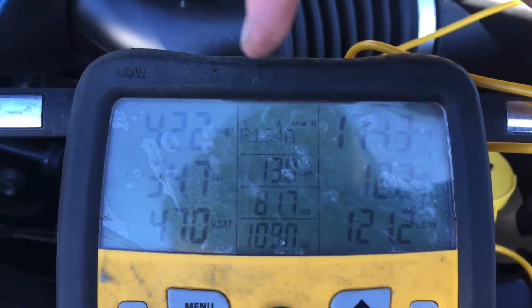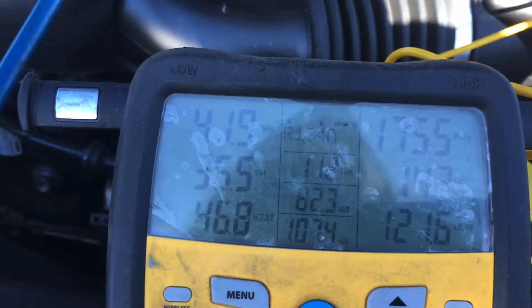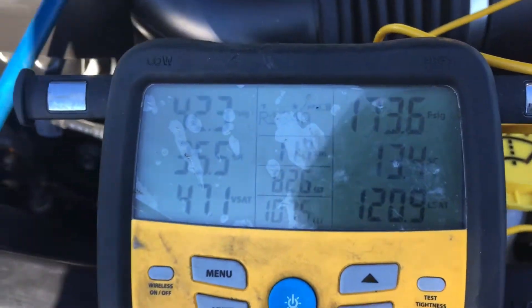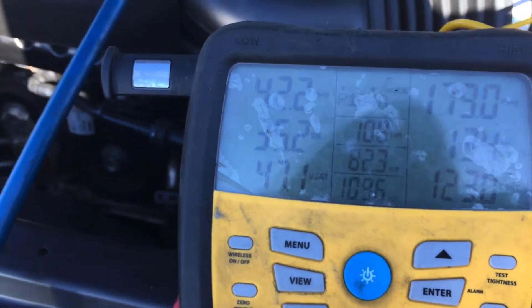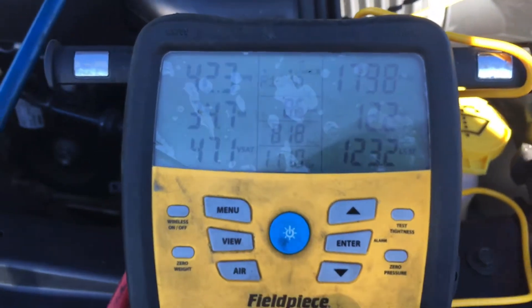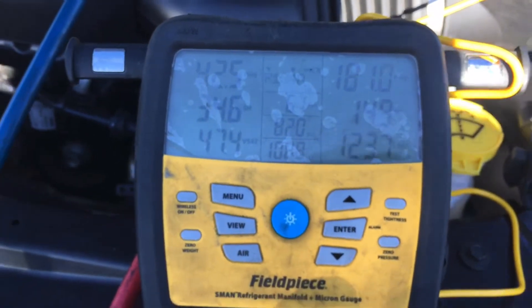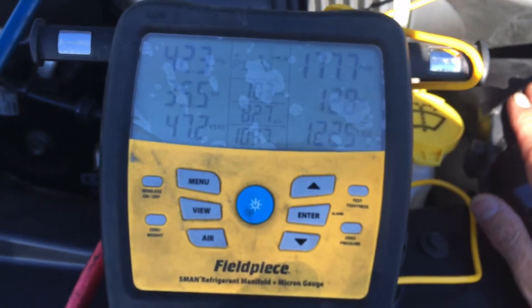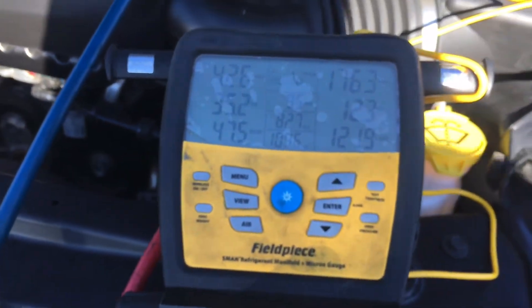We're around 175 high side, 42 low side. I hear these guys on YouTube who are filling up with a can saying 'oh we're supposed to hit 150,' 'oh we're supposed to hit 230' — it's always a fantasy number they're pulling from somewhere in the lower extremity of where their brain is sitting. You get to look at this condition on this day with this humidity — and I'll always say that, because it changes every day. As temperature changes, as the sun hits the vehicle or doesn't, as the humidity goes from 13% to 95% — all these numbers will change and none of them will mean anything anymore.